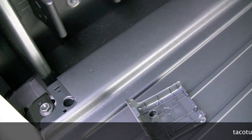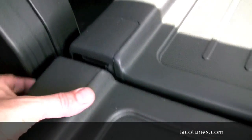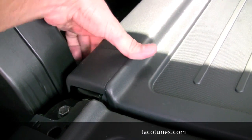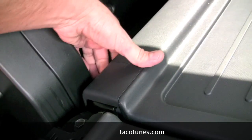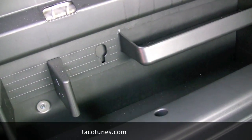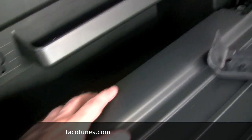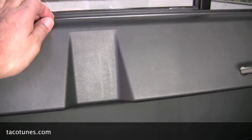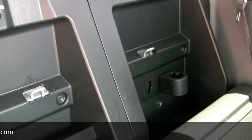For the top part of the seats, there are little plastic covers that expose the bolts - there's one here, here, and over there, a total of four. You pop them off from the back and slide them back. To remove this back panel, we remove three bolts here and three bolts on the other side - those are all 10 millimeter. You start up here and pull away and you'll hear some popping. It's a little intimidating at first but it's actually really easy.